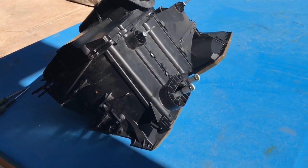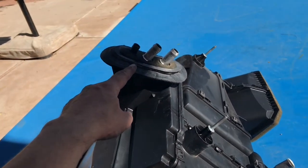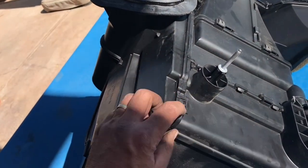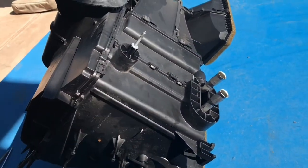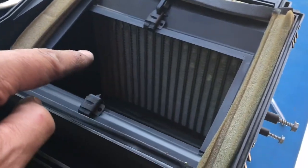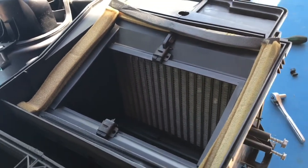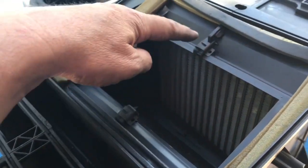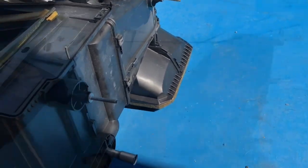Here's the core unit — something I've been working on for days on my off time. To get to the evaporator core it's more hidden; you have to take off the heating core first. Take these clips off — don't lose them — and these little flaps here, be careful they break really easy. The whole thing comes off and then you can make your way down to the evaporator core. With the heating core off you can now see the evaporator core, and even with the naked eye I can see some tracer on it.